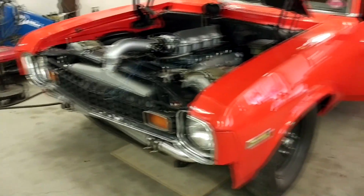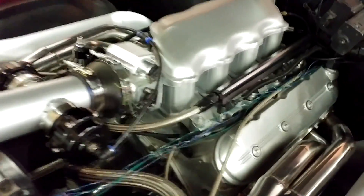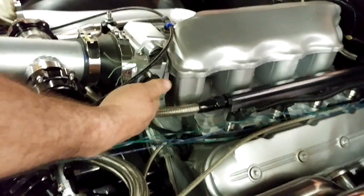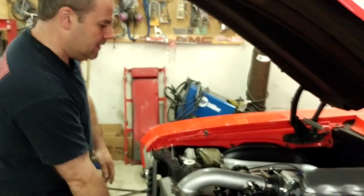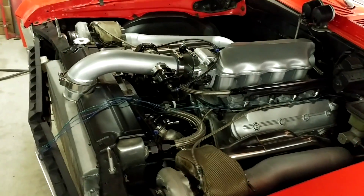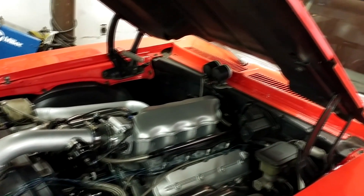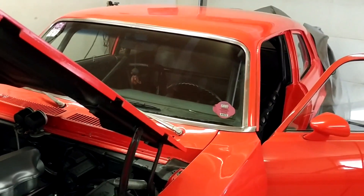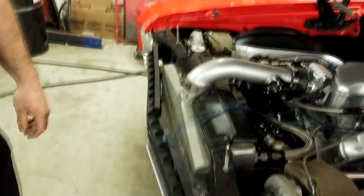Rob's 1974 Nova — it's got a 5.3 with twin S366 turbos. It's in a bunch of previous videos on our channel if you want to check those out. I got the injector wiring done, they're all wired up, the throttle position sensors are done, and these are the wires for the idle air control valve — the stepper valve. I just have to hook those up now, and then the O2 sensor, the tach, all the stuff that goes to the back, all the positive wires and fuel pump — that's all hooked up.